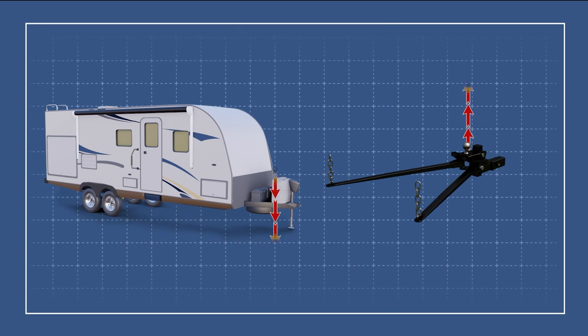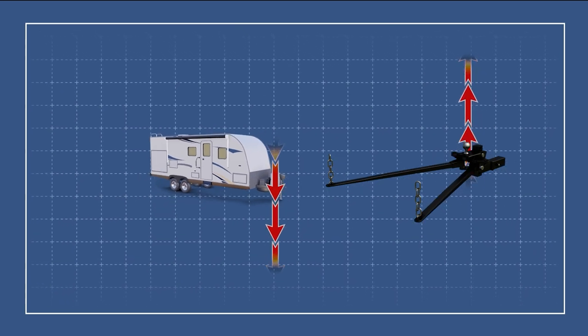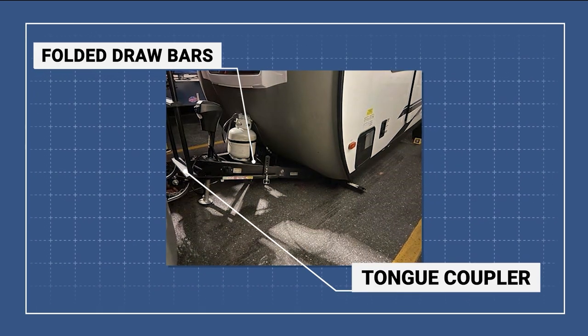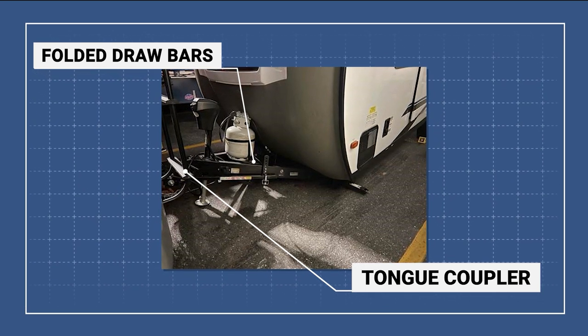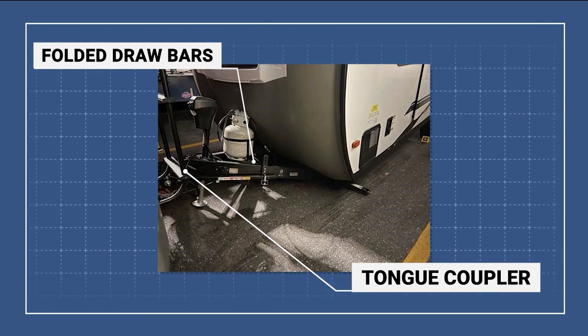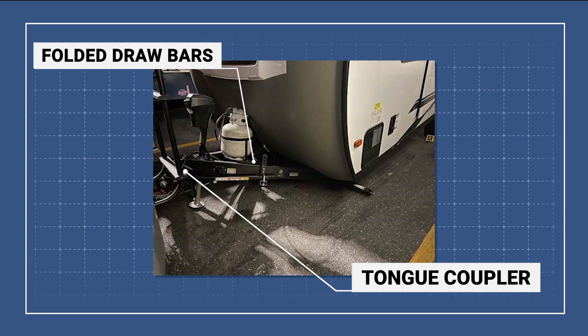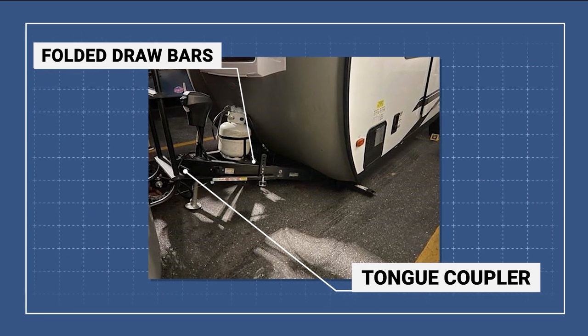This means that a large heavy-duty axle distributing weight onto a smaller, lightweight trailer — which is well within the truck's towing capacity — might fold or wrinkle the trailer's drawbars with the thousands of pounds of lift generated by the weight distribution hitch. Once the hitch load and spring arm force are combined under these conditions, the risk of damage to the trailer is much greater, especially when traversing off-road or cross-country conditions.